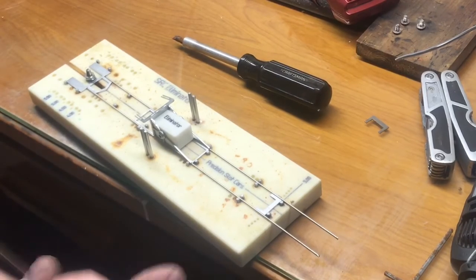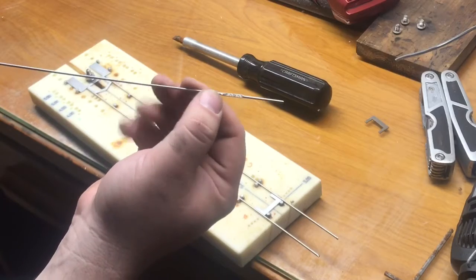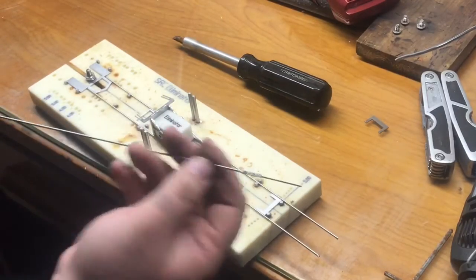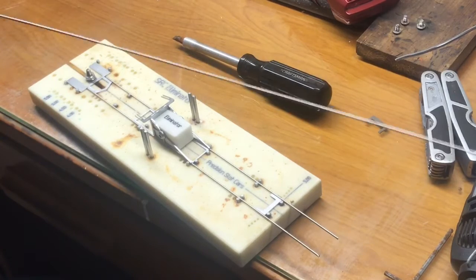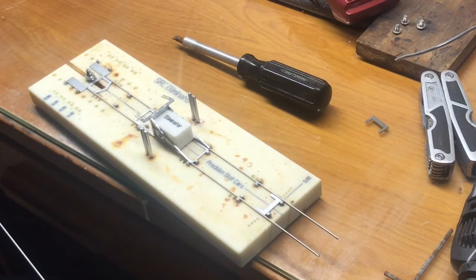Okay. These right here are about a 3-foot section roughly. They have a flat stamped into them that says the alloy of the metal. Obviously you can't use that, or I guess you could, but I always cut it off right before that, and then the same on the other end. It will take 1.5 of these roughly to build one of these Eliminator Pro chassis.